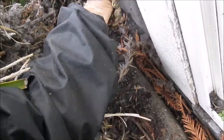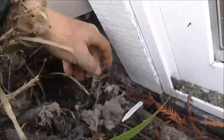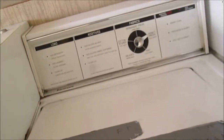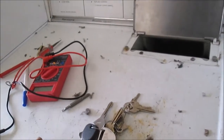This is pruning season, so that's definitely something to address. Stick your hand in there and make sure it's flowing. Turn the machine on and watch the airflow — make sure you have good flow. In a place like this, you should have a sign that says users must clean their pockets, because if people don't clean their pockets, debris can get stuck in a water pump or cause problems in the dryer — causing the blower fan to stall or clogging up the vent system.